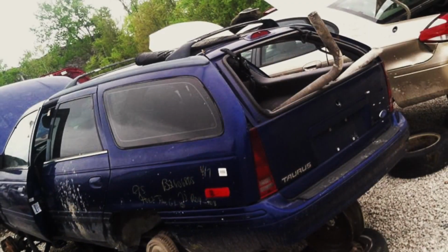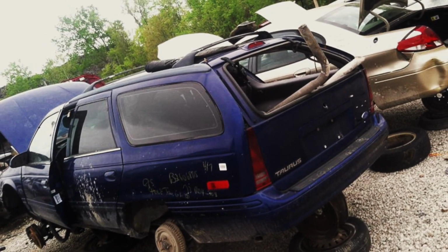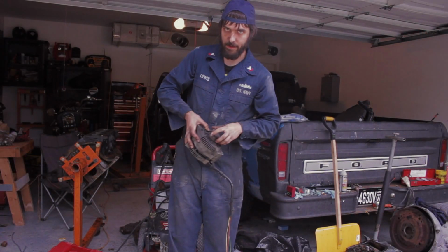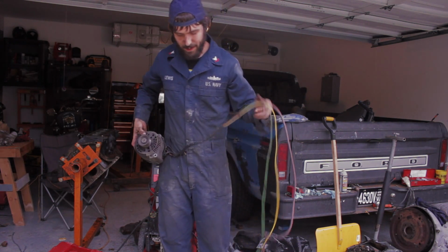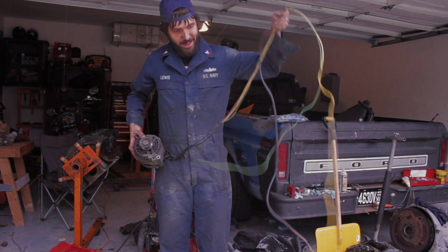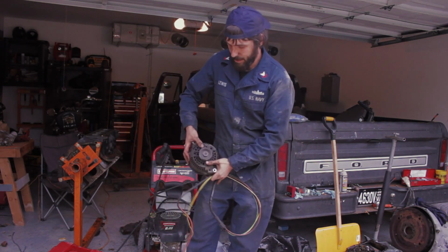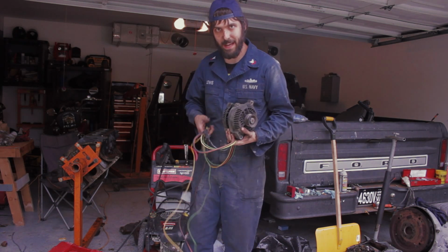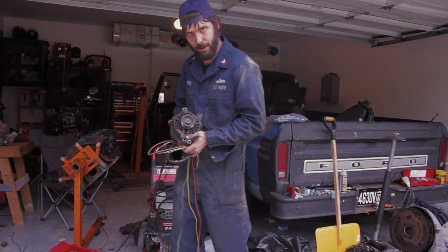They had these big nice 3G alternators that have a bracket that's very FE friendly. I have to shim it a little bit, change the serpentine pulley into a V-belt pulley. You need to get as much of the wire as possible, so I did so. So this should make it to where I can run the electric fan setup and a few extra accessories and have a vast improvement from the 1G alternator that is barely adequate for the truck.